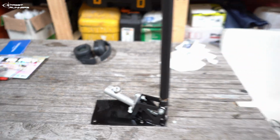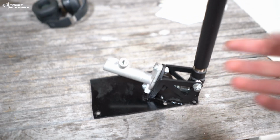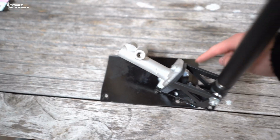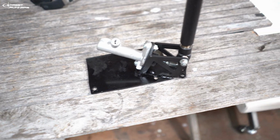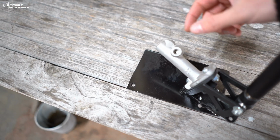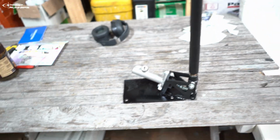This is what I currently have for my hydro setup. There's a 4mm steel plate where the frame of the hydro is welded to. So I have the original 3 bolt holes where the airbag ECU was sitting in. Now I'm going to bolt the hydro in, put all the banjo bolts in and the brake lines to it, and then put it in my car.